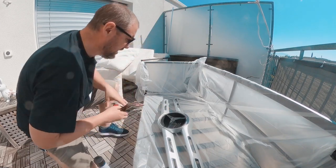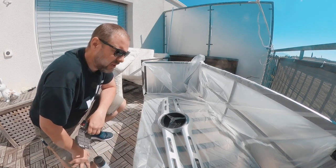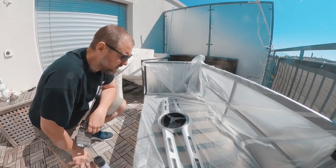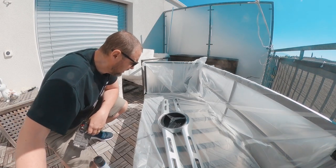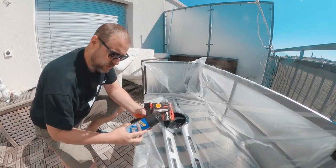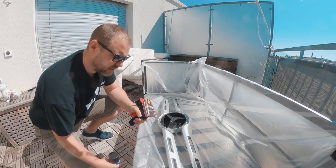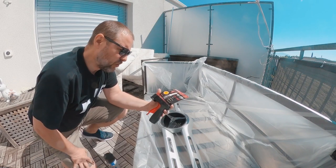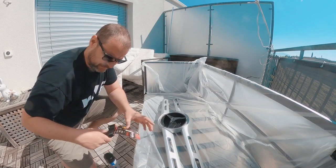It's very sunny and warm so it's probably going to dry very quickly. Between coats, we'll allow about 10 minutes of drying time. I think we're going to do probably seven layers — it's recommended to do a minimum of four, but the more the better. Some people do 10; I'm aiming for six to seven. For the spray, obviously PlastiDip spray, black mat — that's what we're going to use. Also having a power grip tool for the spray can. So let's go.